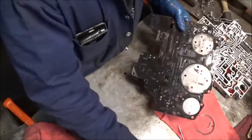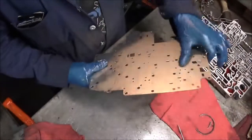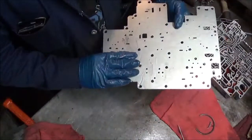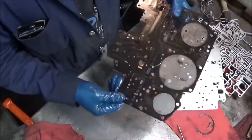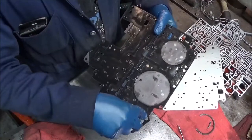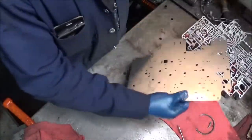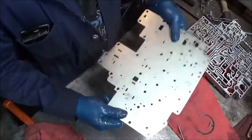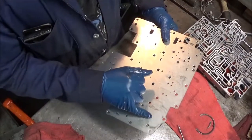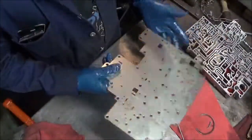It's best to change that plate if you have the cracks. This plate is made by Superior — it's called a super tough plate. It is thicker, and it also solves problems with bypass leaking. Old transmissions had a hold-down round circle piece that became flimsy over time. The thicker plate clamps down better when you put the two large covers on, and it solves the hairline crack problem. I would say always replace it.